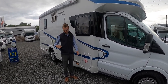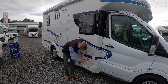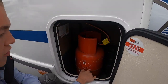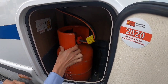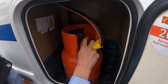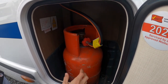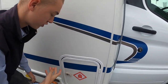This opens with the round-headed key. Once you've turned it, you can open it up. In there you'll get a 6kg gas bottle. Always make sure it is strapped in. Attach the pigtail to the regulator — it is just a left-hand thread and hand tightened, so no need for a spanner. Then you turn it on at the bottle. Always make sure it is turned off when travelling, just to be safe in case you were involved in a collision, so the gas is securely switched off.